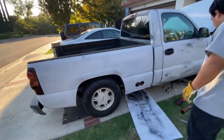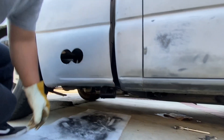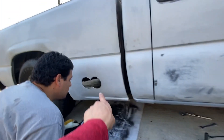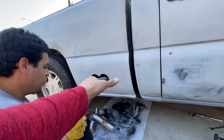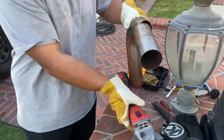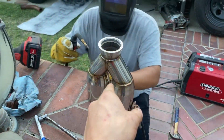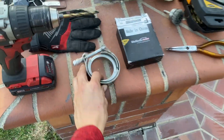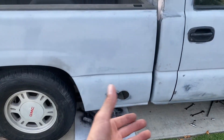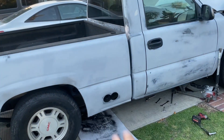We're going to have to do a 90-degree bend from the second muffler, then a few curves to get to the tips. One of the things we're going to do for the tip is put a V-band on it — that way whenever we need to take the bed off for paint or whatnot, the tip just slides right out and the bed can come off pretty easy. You don't have to take the whole exhaust off, just the tip.